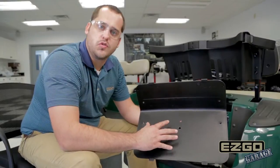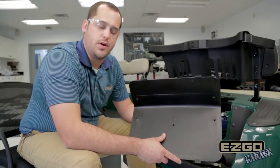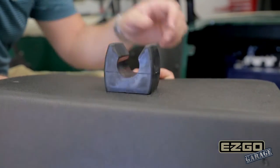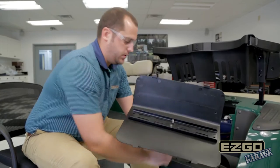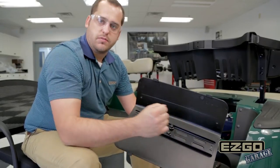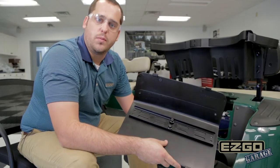Now that we have all of our holes drilled in the motor access panel, we need to assemble the lower tow bar retaining bracket. To do that, we grab the rubber clasp and insert it through the two holes on the front side of the access panel, grab the reinforcement bracket, put it through the two studs, and put the two nuts on. Now what this does is this distributes the force of latching and unlatching the tow bar across that back panel to keep it from warping.